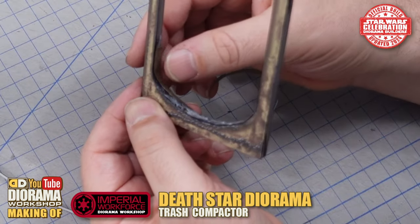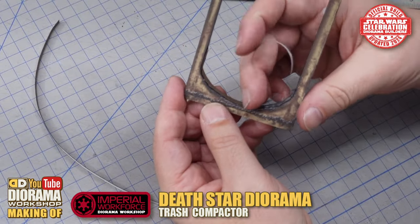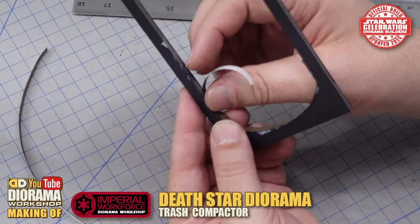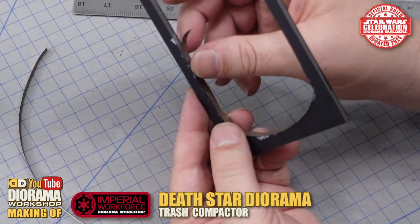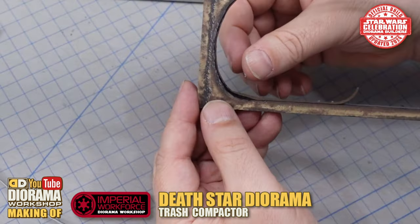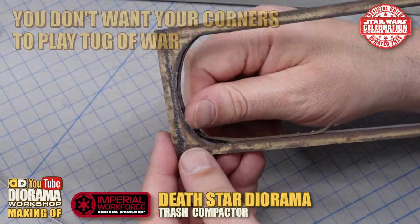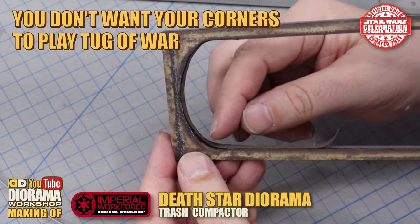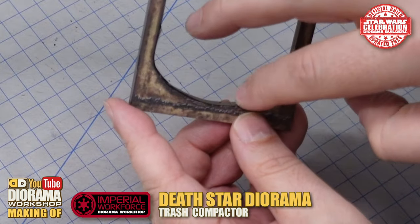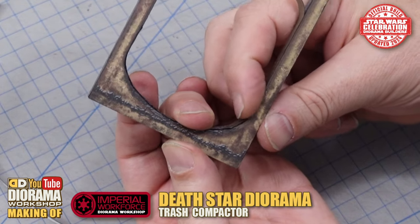Peel this. So you just want to start over here. And then we're going to bring it around like we did the other one. See, with the glue, we're able to play with it. Here, we're going to align this. When we push here, see how it's sticking out a little bit? You don't want to press and then pull this one off. You want to be pressing and lower this while you make the contact with the curve. You just want it to be flush with the door frame. Keep your finger here if you want it, and then it'll bring this down easier.